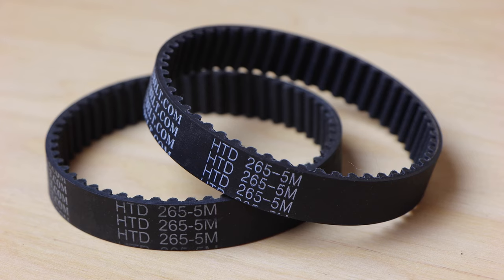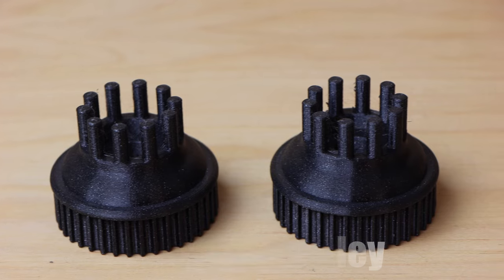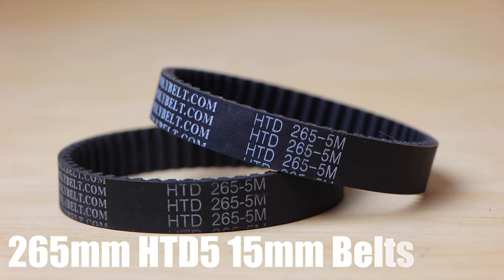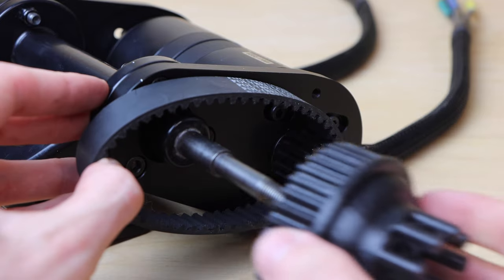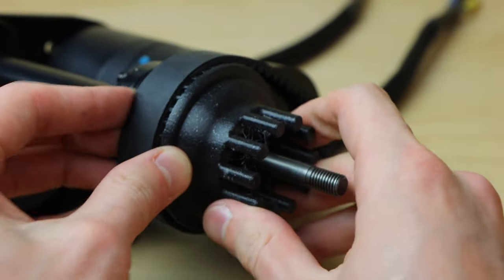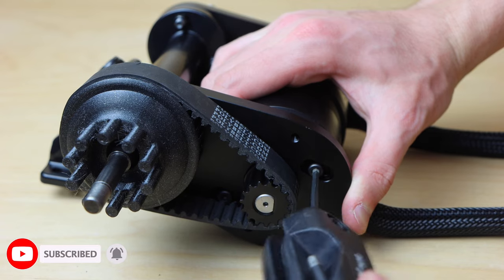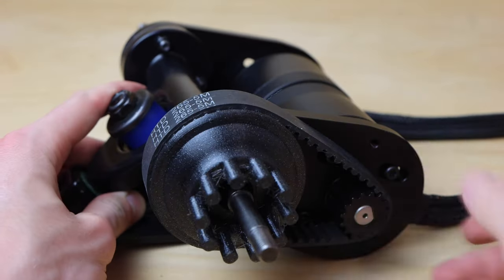For Step 3, the wheel pulleys and belts are needed. The wheel pulleys are 38-tooth, 15mm-wide HTD5 Kegel wheel pulleys — shown here as prototype 3D printed samples, but the final version will be injection-molded glass-filled nylon. They are press-fit with a 10mm inner diameter bearing to fit the stepped axle. The belts are standard 265mm long, HTD5, 15mm wide. Slide the belt over the hanger and axle, align it with the motor pulley, then slide the wheel pulley onto the shaft and rotate it into place. Set belt tension by pulling the motor back along the slots and tightening the M4 bolts. The general rule: make the belt as loose as possible without slipping. Repeat for the other side.